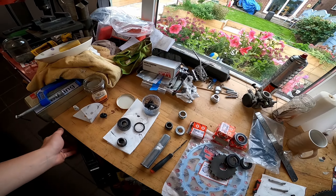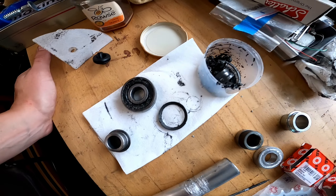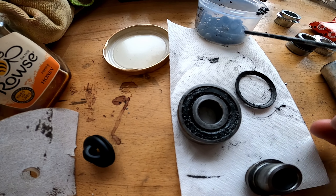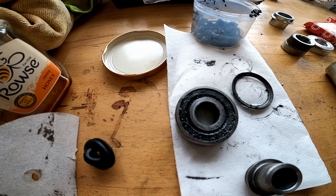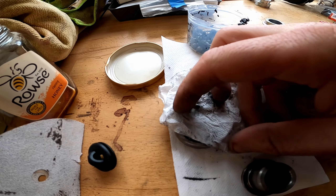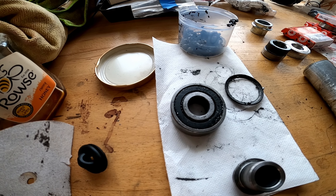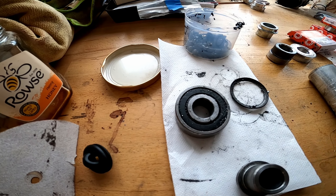This is all on me. Done a bit of an inspection — you can see all the damage piled up in that little lid. This is the bearing from the other side and hopefully this comes out in the video — you can see quite a big score in the seal there. And this is what's left of the seal from the failed bearing. If I turn this one over, you can see the outside edge of this other bearing is absolutely fine. There's a little bit of debris here from one of the other spacers — I think that's from when the whole centre locked up at some point.